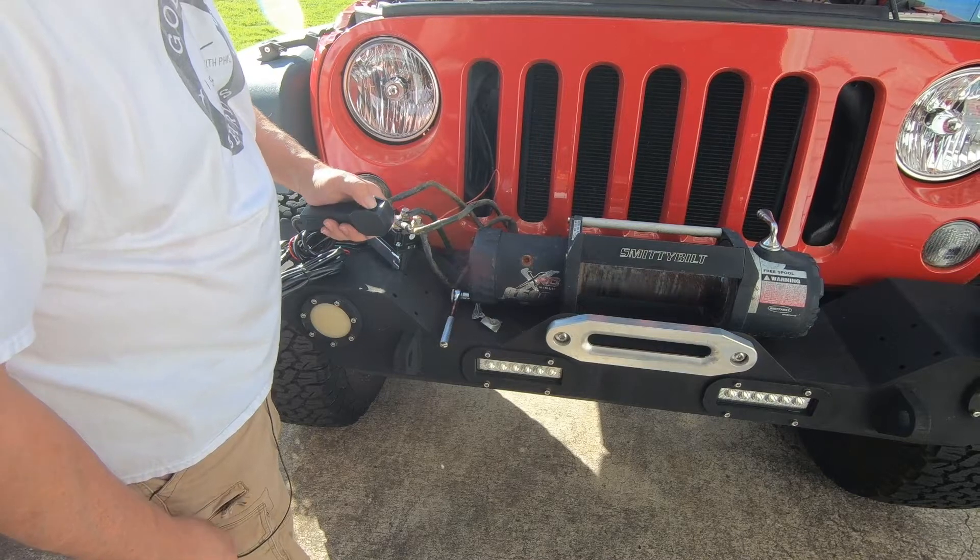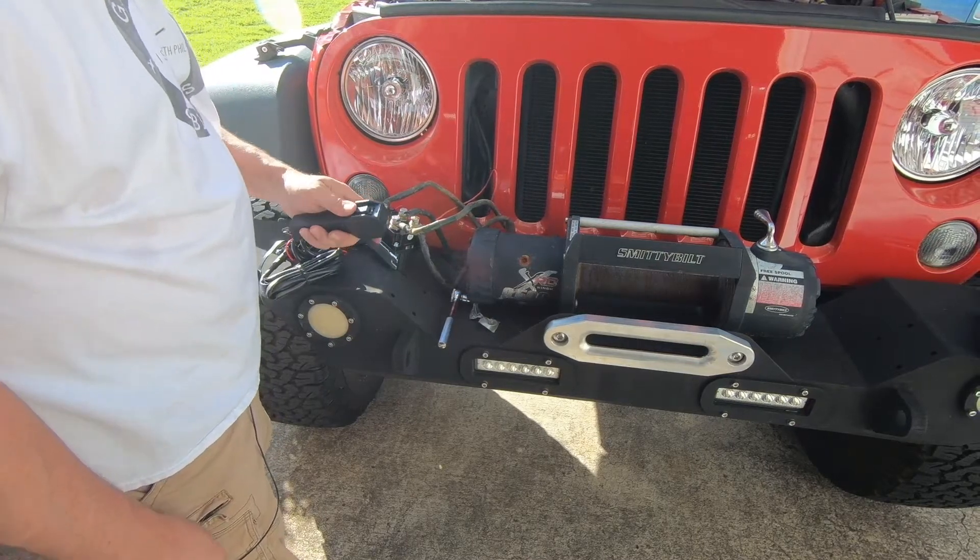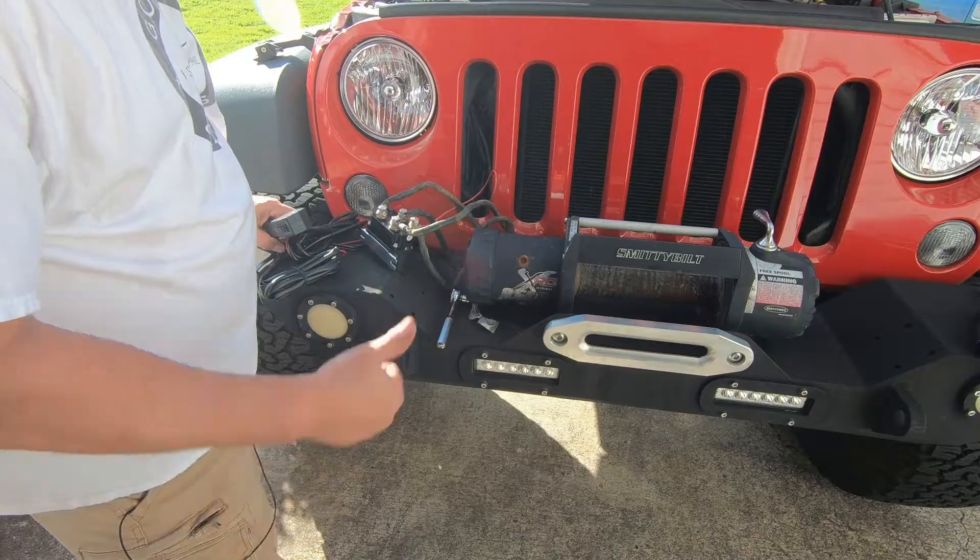Let's see if she works. In — hey look at there — and out! Alright guys, it works. Okay, that's really all there is to it, it's very simple. I know that wiring can be a little bit intimidating to some people, but it's really not bad once you understand the basics. All you're doing in this situation is switching power from one pole to another one, or to the other one, depending on which way you mash the trigger switch.